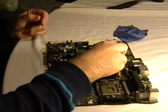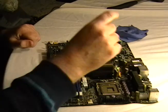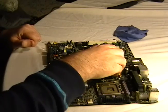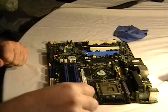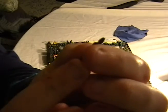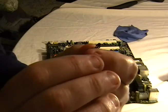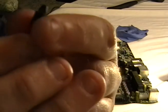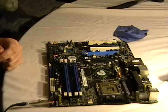Just like that — let me show you how it's going to sit. Now let me show you how they actually connect it. This goes back to the first episode when I told you about using nylon standoffs for non-grounded mounting points. This is the system NVIDIA used for my particular setup — these little push-style clips. There's a spring inside a plastic cylinder, and this shoves through the hole and grabs onto the back of the motherboard with that V-shape. They actually use plastic when they don't want there to be any metal contact.